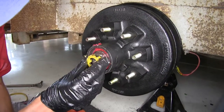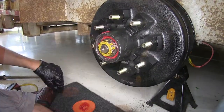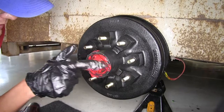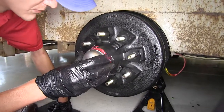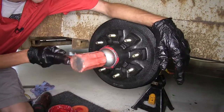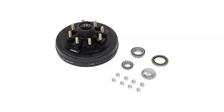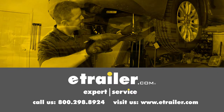Now I'll reinstall our tab, which holds our lock nut in place. Before we reinstall our grease cap, I always like to put a little bit of grease in there so it can work its way into the bearings if needed. We'll take our new cap, place it into our hub, and tap it in. Clean off any excess grease. That completes our installation of the E-Trailer Axle Technology Trailer Hub and Drum Assembly for 7,000 lb. axles, part number AKHD-865-7-1-K. Click the link below to shop, learn more, or visit us at E-Trailer.com.